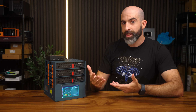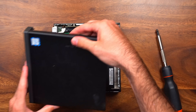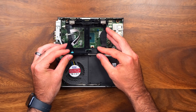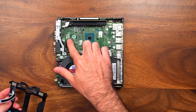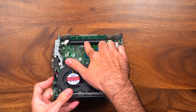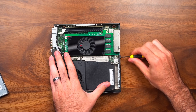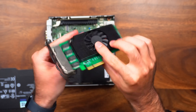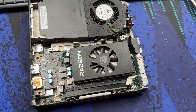In terms of build and functionality, these are pretty sweet. They are tiny but surprisingly expandable. Opening the unit up will reveal some of that expandability. These models come with a two-and-a-half-inch drive bracket and connector by default, which is great, but if you take that out you'll notice what looks like a PCIe slot — and it is — but you'll need a riser kit to make use of it. That gives you a full 16x slot, although note that you only get eight lanes of PCIe Gen 3. You can fit a half-height card in here, and in my experience barely a six-and-a-quarter-inch length card, so that's probably the max.